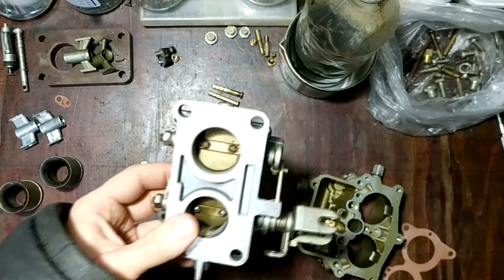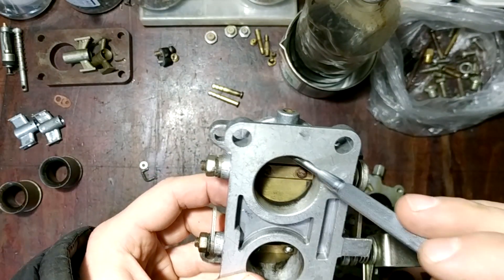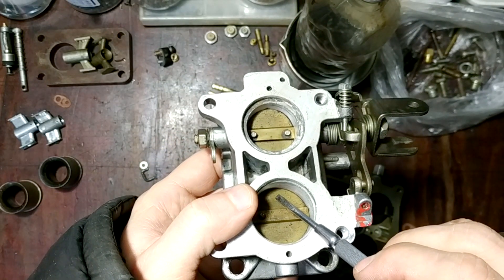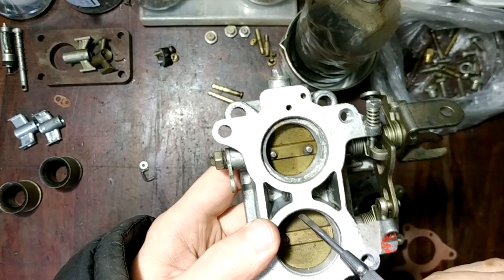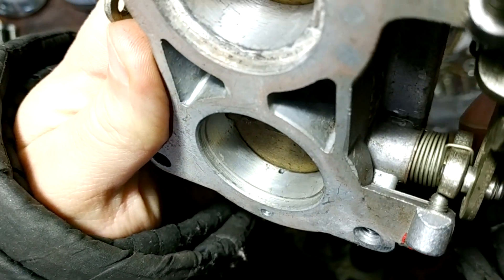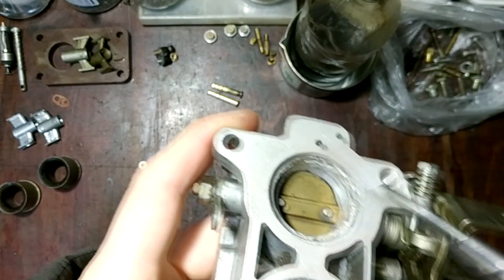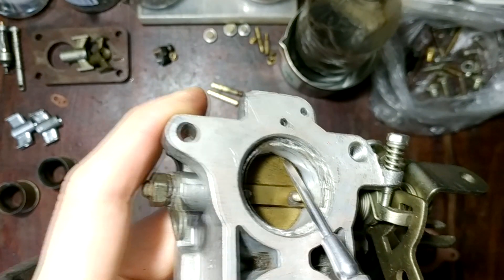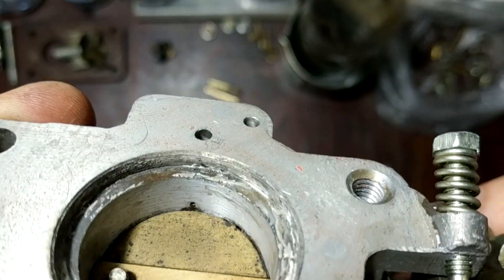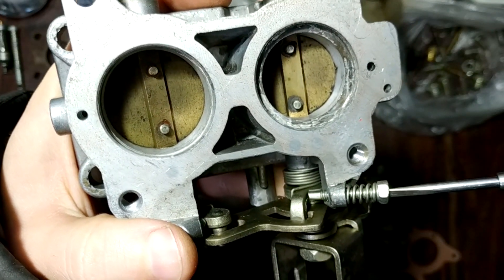About the throttle body: I increased the gap in the secondary throttle just a little bit — in my case, 90 degrees of additional regulating screw — and it will not open the hole of the transition system. I will use a slightly off-plane positioning of this throttle to take extra air for idle engine work. Thanks to this, I don't need to make a strong adjustment of the idle air screw, because the hole of the vacuum advance distributor could be activated by strong adjustment and that would break the ignition timing.